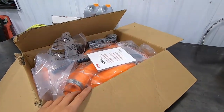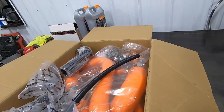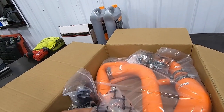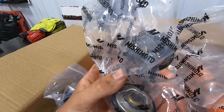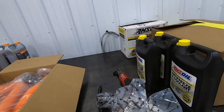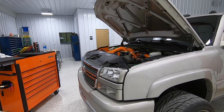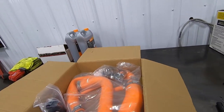This box is from PPE and we've got some orange going on. The number one reason we're doing all of this is right here — from Mishimoto, these are their low temp thermostats. I'm doing these because I'm hoping they'll help with the truck building a bunch of pressure in the coolant system every once in a while, especially when running it hard. We did the head gasket tests and everything's good, so hopefully these will help.